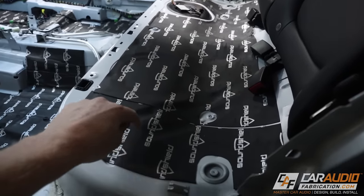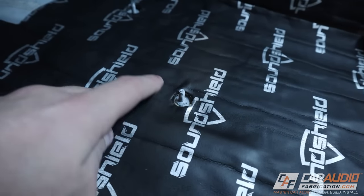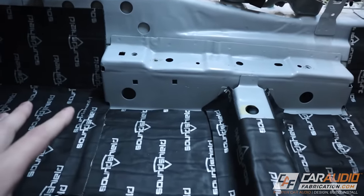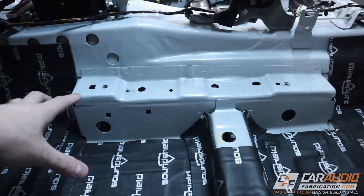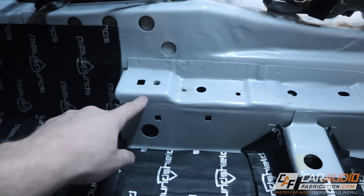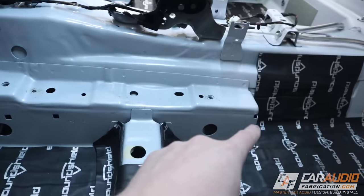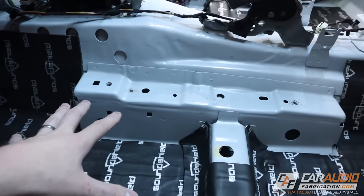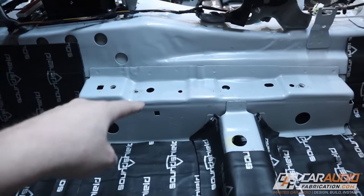Another good application for the slim material. I also make sure that I leave hole cutouts on locations with threaded studs or other areas you might need to access. I also generally avoid the seat area — one, I don't want to mess with the fitment of the seat, and two, this is engineered to be extremely solid because it's holding the seat. That's where the seat bolts into the vehicle, so we don't really have to worry about that area vibrating or resonating nearly as much.